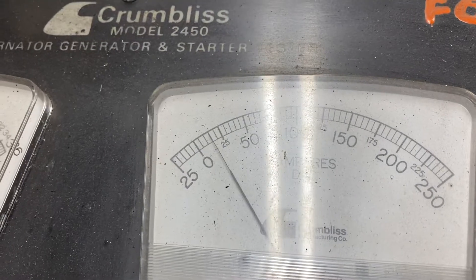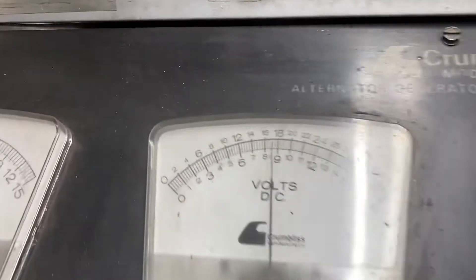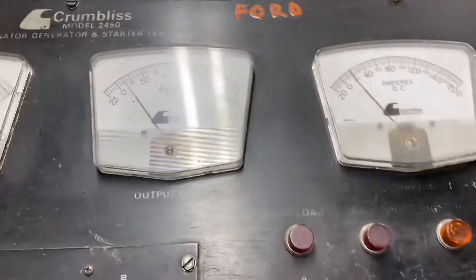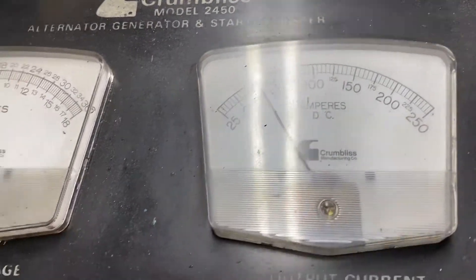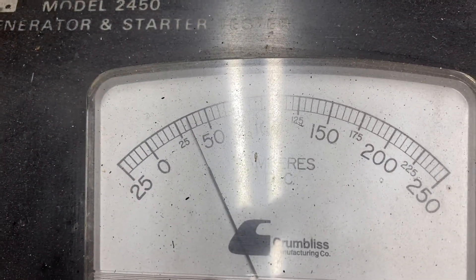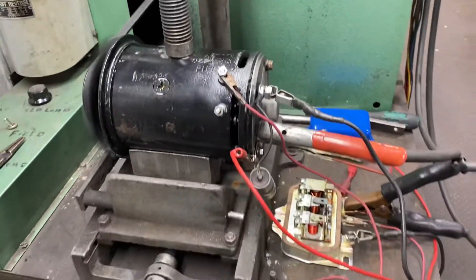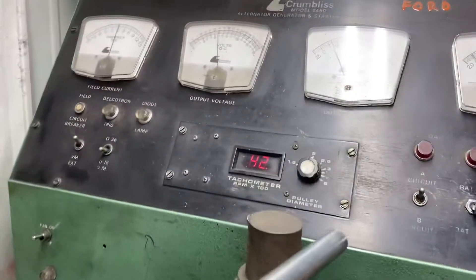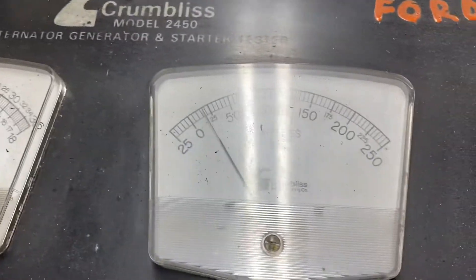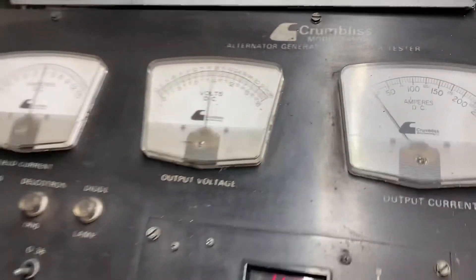See, now I'm charging a steady 15 amps. About eight and a half volts — that might be a little much. Let me put a load on it. There's 35 amps. That's exactly what this generator is — it's a 35-amp unit. There you go. That's how you adjust the regulator.